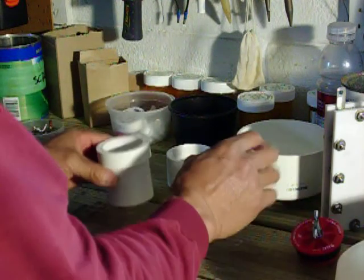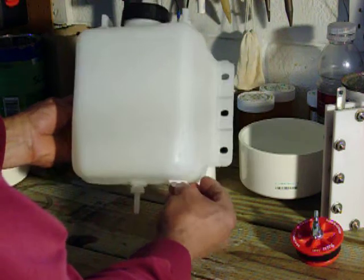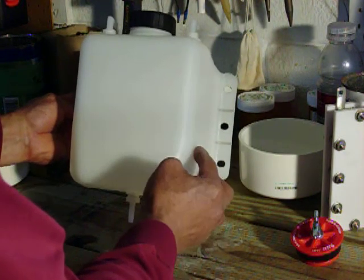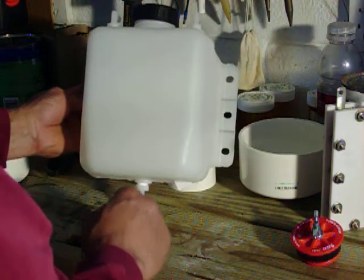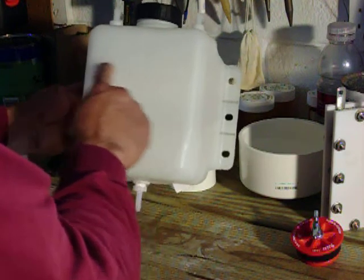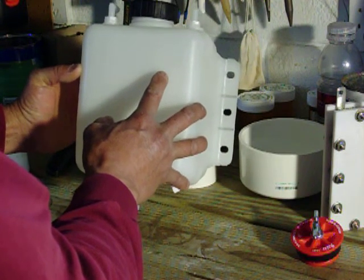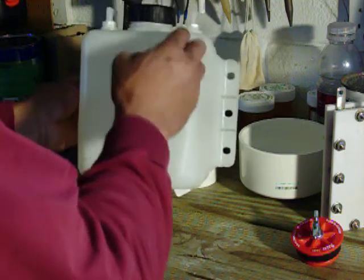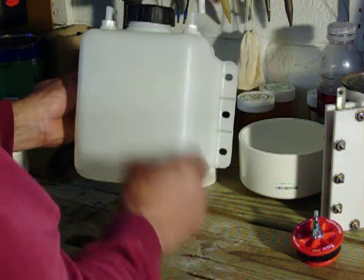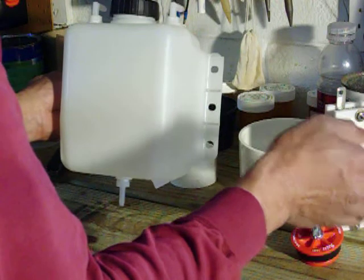Originally these were the reservoirs I used, and I still have them, but I'm recalling them and retrofitting the vehicles I put them in. This is a 3-quart capacity reservoir. You can fill it about 2 to 2.5 quarts and end up with the water line about here. But if you put them on a vehicle with a stiff suspension — like some of the F-150s I've installed them on — the water has a wave effect inside. Eventually the water gets picked up and pushed out to your bubbler through the gas exit hole, which I've seen happen and I'm really not happy with.